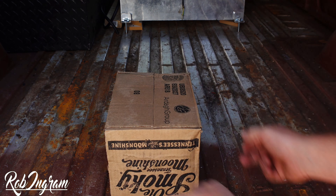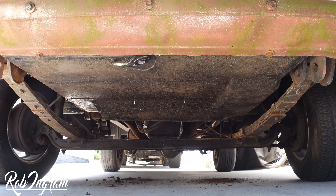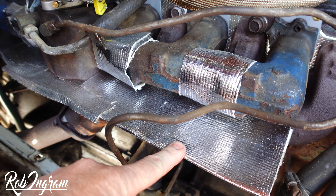I mean, you can't touch the doghouse, which is normal. But the more I look at it, Ford really didn't design this very well — they designed it like a box tucked up towards the front of the van. Then I went and Googled it: why is a 1966 Ford Econoline with a 240 getting warm? And of course everything you see is: do you have a belly pan? Check. Have you flushed the radiator? Check. Have you replaced the radiator? Check. Are you running a better fan? Check. Have you created a heat shield? Check.